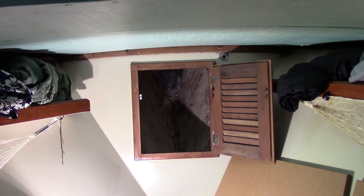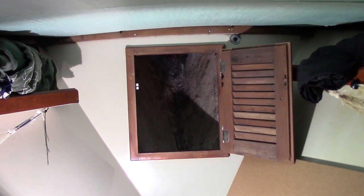There's no real floor in it. The primary reason I did this is that when you bring the anchor up and put the wet rode into the locker, the water drips off of it. I rinse it off the best I can, but I don't have a freshwater rinse. So all of that water just drips down this trough, all the way down to the bilge. There's also a little compartment area where my depth sounder is. I just got tired of that smell and that dirt — it was constant. I could clean it once a month and it would still smell because of the mud washing off, the dirt, the salt, washing off the rode and going right down the center of the boat.